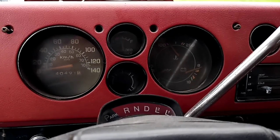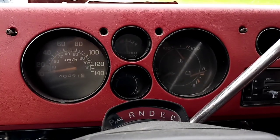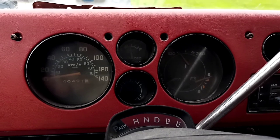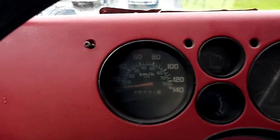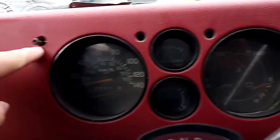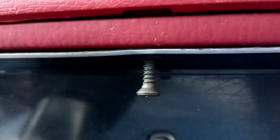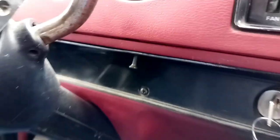How to replace your speedometer, any broken gauges, or anything in the dash — or if you just want to replace the lights in the dashboard. You have to take that screw out there, there's one there and there's one right here, and there's one right there as well. Underneath, hanging down, there's one there, and to the left of your ignition there's one right there. Let me zoom out and show you where it actually is — I'll go around the steering wheel and come back down.